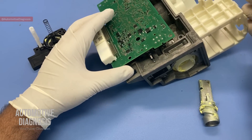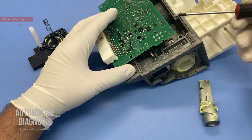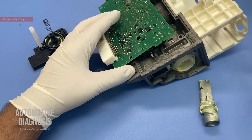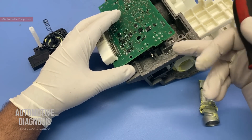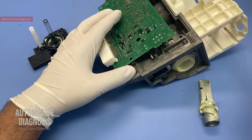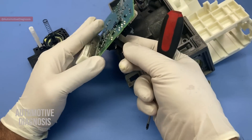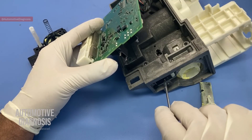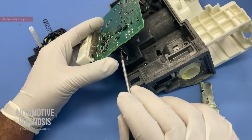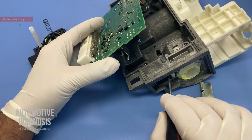Let's see how this steering lock mechanism works. When you want to turn the ignition switch on before starting the engine, the first thing that should be done is to release the steering lock — this must happen before starting the engine. If there's anything wrong with this steering lock, you won't be able to start the engine. So the moment you press the start-stop button, the first thing the start-stop unit does is unlock the steering lock. For that, these two pins are inserted into the DC motor, and the start-stop unit provides positive and negative on the correct polarity.